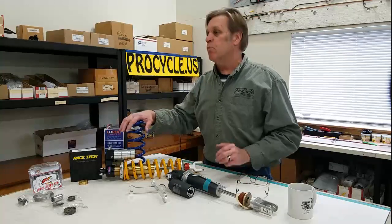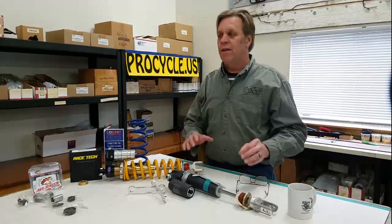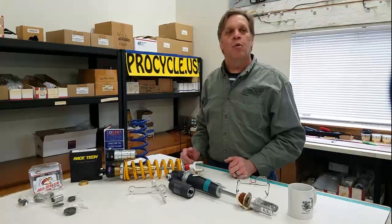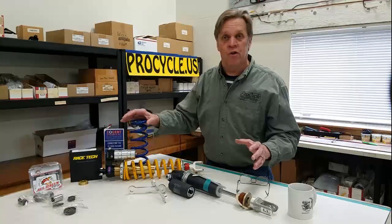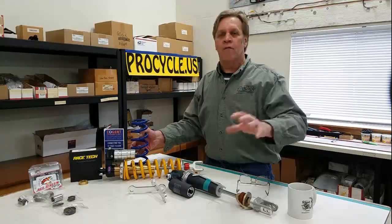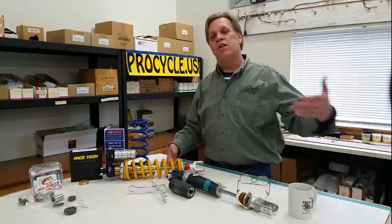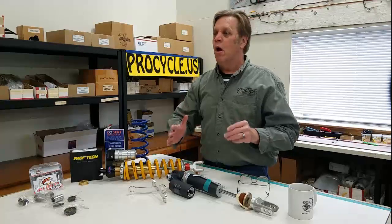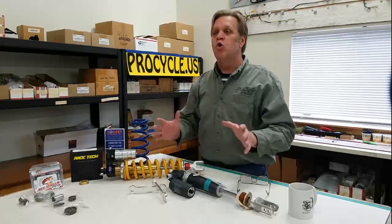The first question we usually get is about spring rates — what spring rate should I have, how do I determine spring rate? We determine spring rate just like we did with the front forks. It's the weight of the rider with your riding gear on; that is the constant number that's always going to be there. Most rear shocks have one, maybe two, rarely three spring rates to choose from. It's not as critical as the front to have multiple choices. For the DR, for example, we've got the 7.5 — that's for rider with gear roughly 240 pounds and under — and then 240 pounds and over is going to be the 8.3. Just like fork spring rates, shock spring rates have an overlap — about 10% into the next spring rate. If you're going to do a lot of street riding, get the softer one; if you're going to do lots of off-road riding, get the firmer one, should you fall into that zone.